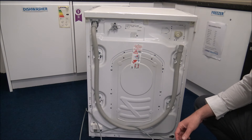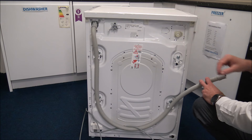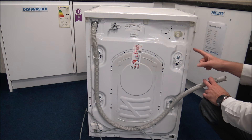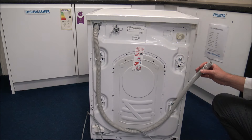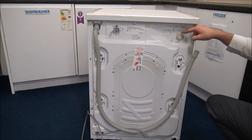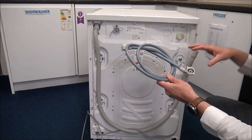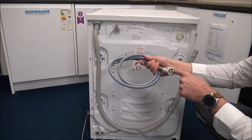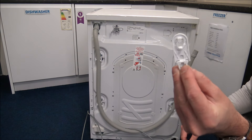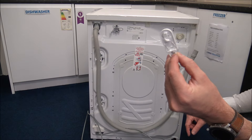I'll quickly show you around the back of the machine. The first thing to point out are these four bolts — these are called transit bolts, designed to hold the machine steady during transit, and they have to be removed. You've got four of them located behind the waste hose. If you don't take them out, it will damage the machine and that will not be covered under the manufacturer's warranty. The waste hose is at the top left, the main supply is at the bottom left, and the water supply is at the top right. A new hose is included, so it's recommended to use it. Once you've removed the transit bolts, there are four plastic plugs in the instruction packet — just pop these in to seal the gaps at the back.